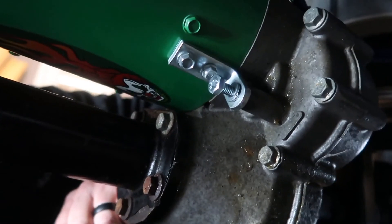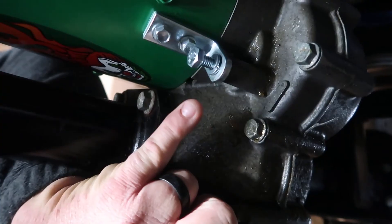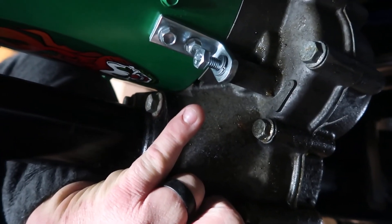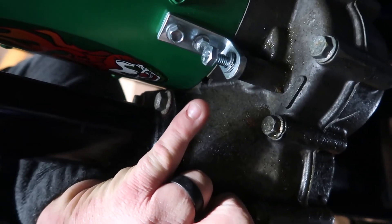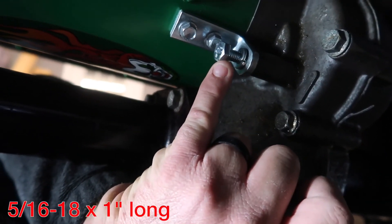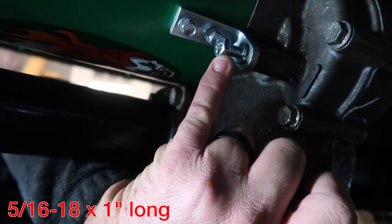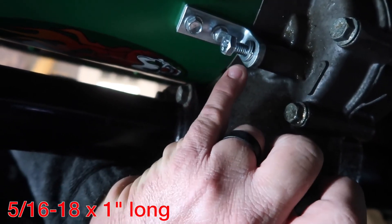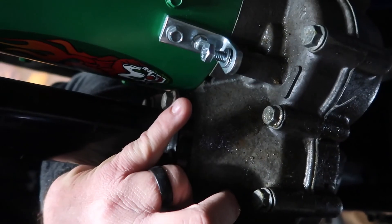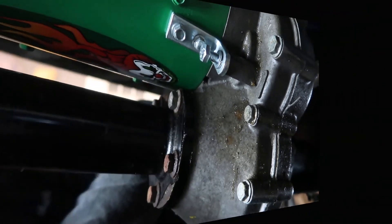One thing I didn't mention when reviewing the motor out of the box: there is an L-bracket here on your Club Car President and DS. This bolt — I had to buy it — is a 5/16 by 18 thread, one inch long. It was about 15 cents, and with the lock washer it takes a half-inch ratchet to tighten it into the housing of the differential.